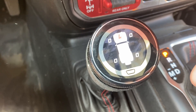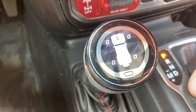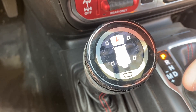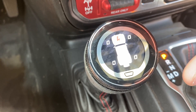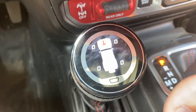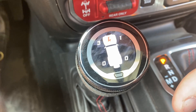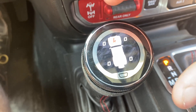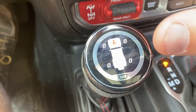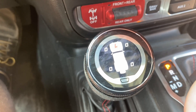Can I adjust that while I'm driving, or does it do it automatically? In auto modes, it's automatically adjusting. You can still do fine-tune adjustments, though we say don't do it while you're driving. Even if you hit the brake right now — there you go, it actually stiffens. We're at a little bit of an angle, so you notice how the left front was three and the right front was higher, meaning it didn't stiffen that shock as much.